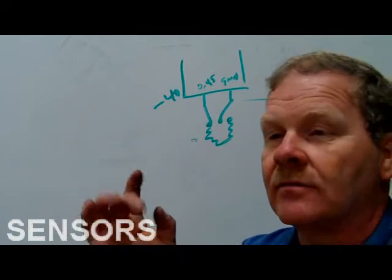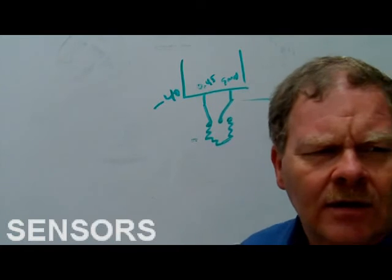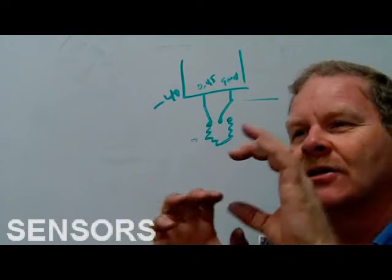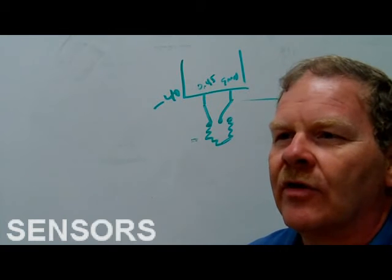It'll have a ceramic resistor, made so that you've got a contact sliding on that little thing. You see it on your headlight switch, that little spring-looking thing that the contact slides on. It's got a ceramic resistor, something like that, except a little better quality, to operate a fan, because fans pull 30 amps or something.